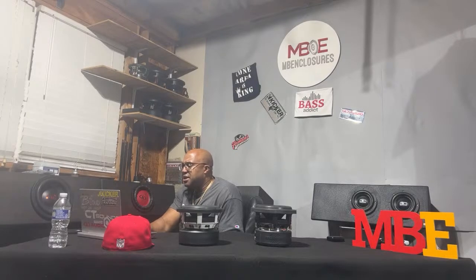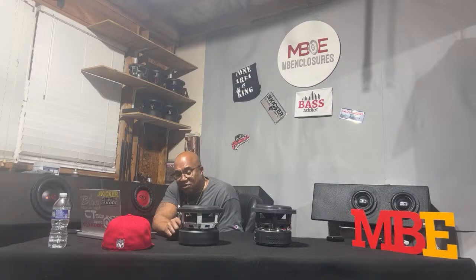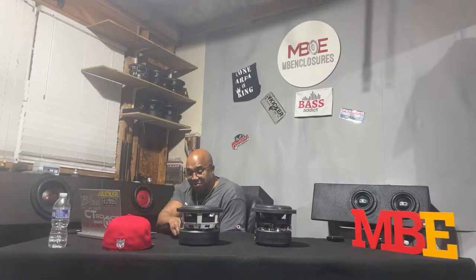And that Crossfire got a booty. He got a booty, boy. He wide and fat. If you use 10 gauge speaker wire, you gotta take the rear boot off to put it in the box, because his cutout is the same size as his magnet. It's a tight fit. If you use 8 gauge or 4 gauge, you're not doing it with that boot on. So you gotta put it on once it's inside.